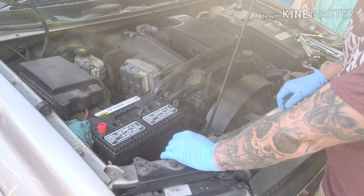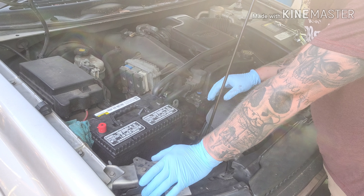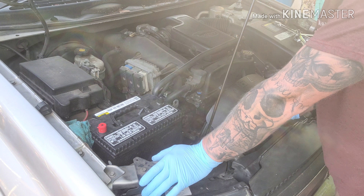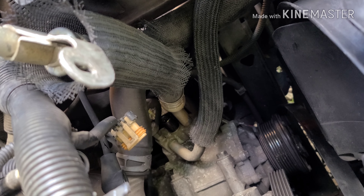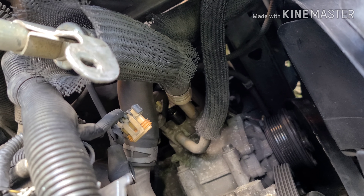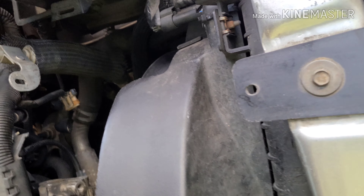Okay, so if you've made it this far, you've skipped the 15 stages of hassle from Chevy and made it to the final boss, which is the AC compressor — that's kind of why we're here. I went and got some blue gloves because you're going to be dealing with Freon. What we're going to do is crack this line right here — it's also a 15-millimeter. You want to barely crack it, just enough for it to drip out and discharge your system.